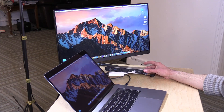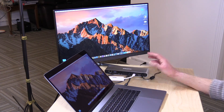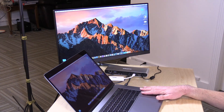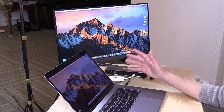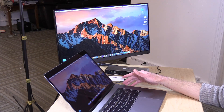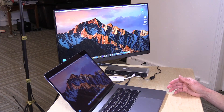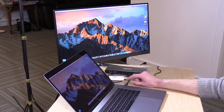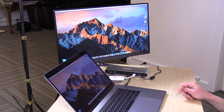This is a way to get all your desktop ports available very conveniently — show up to work in the morning, plug in your single cable, and you're good to go. On power delivery: if you have your power adapter connected along with the dock, the Mac will draw power only from the power connector and automatically turn off power delivery from the dock, so no risk of overloading. There will also be a version of this dock with full power delivery over a single cable, which is definitely worth considering if you're in the market for a Thunderbolt dock — especially because it works on both Mac and Windows.